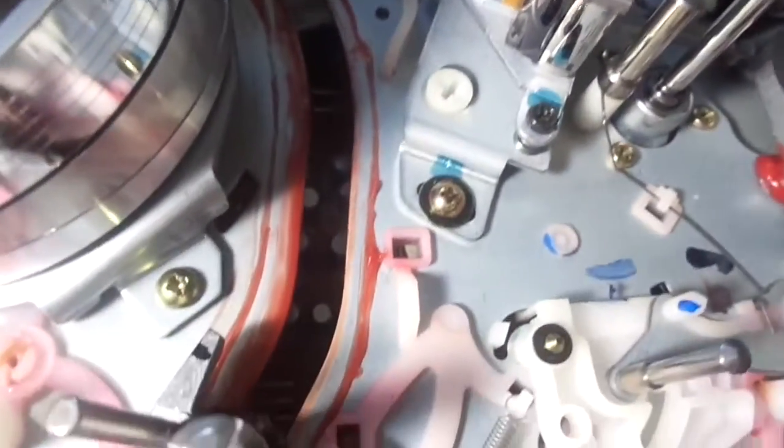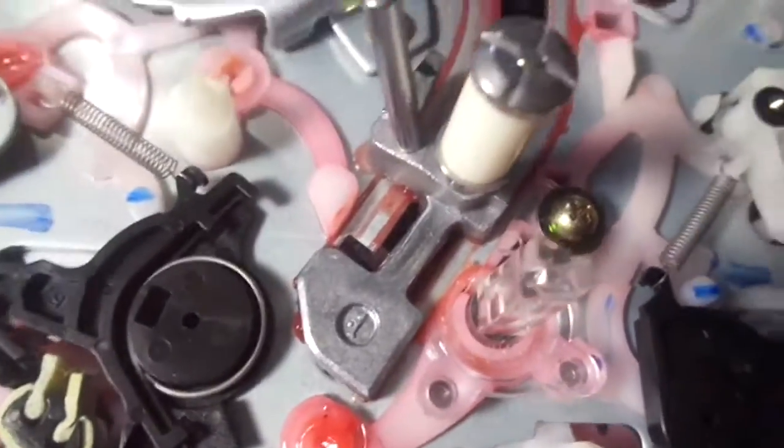So, again, let me go over this with ya. These tape guides. Looks like there's blood, but it's not. It's just grease. Everything looks perfectly greased. Here's the pinch roller assembly. Here's the mechanism, the gears and all that. Loading motor, like I already showed you. Power supply. Worm gear assembly. Half loading arm. Goes onto the capstan. Like so. And, you know, all the usual stuff.